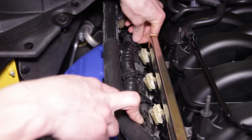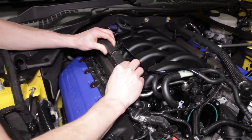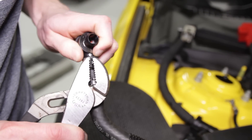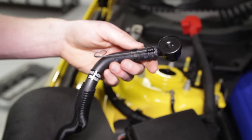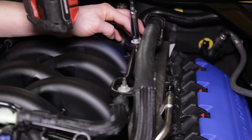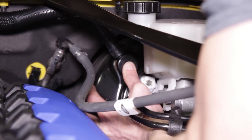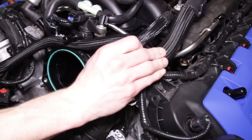Reconnect all the fuel injector electrical connections and reinstall the foam fuel rail covers. On the passenger side, reinstall the heater hose support, reposition the hose, and torque the previously removed 10mm nuts to 62 inch-pounds. Take the factory vacuum tube and slide back the two hose clamps. Remove the plastic fitting from the brake booster grommet and install it into the provided vacuum tube on the side with the longer hose. Position the driver's side heater hose support followed by the vacuum tube mounting tabs, reposition the heater hose, and torque the two 10mm retaining nuts to 62 inch-pounds. Pull the release pin from the hose clamp to secure the plastic fitting, rotate the fitting to align with the grommet in the booster, then push the fitting into the grommet. Position the other end of the vacuum tube over the inlet port on the GT350 manifold and release the pin from the hose clamp.